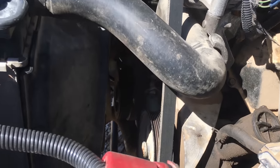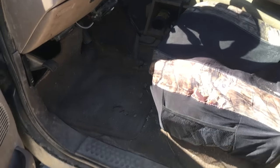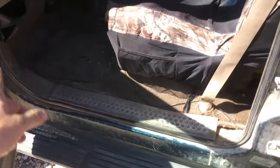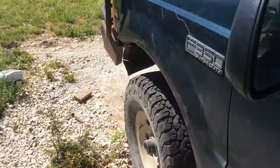To get started, you have that bolt right down there. You got one there. There's one on the other side. You've got one underneath here. You gotta take this pillar, the seal plate off. Oh, I'm sorry, there's 8 bolts holding the cab on. There's another mount bolt right under here. The back one's the easiest ones to get to. And there's one here and one over there. I don't know if somebody's been into this truck before and that's why they're different, but the bolt sizes are all different. So like on this side, I think they're 21, 22, and then over there, they're like 19, and so whichever. So I'm gonna take those bolts out.